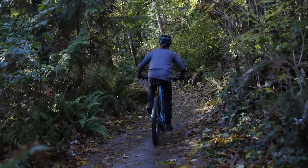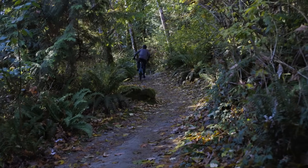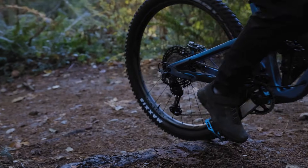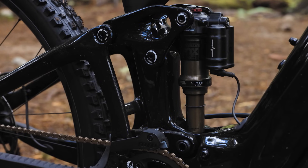From the early LiveValve systems, we had the mentality that you needed to lock it out in its closed position. Not too many people lock out their six-inch travel bikes, and it kind of created an unfamiliar feeling for some riders — anytime your suspension is completely locked or rigid, you're not taking advantage of why you have suspension on your bike. In the newer version of tuning, we figured out how light that platform can be: add a lot of low-speed support but don't close the system off. How much platform do we need to tune out your pedaling movements but still allow the bike to track over obstacles? That thought process goes into the new tuning of this LiveValve system.